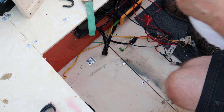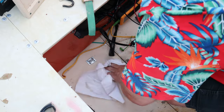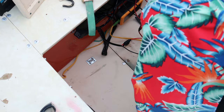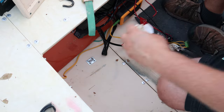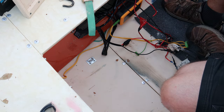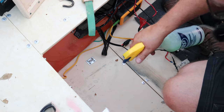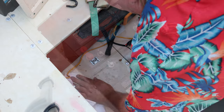There's advantages to the starboard half-inch flooring I put down in this boat. But, mind you, there's plenty of disadvantages as well. One of them would be temperature. In the direct sunlight, this floor will get hot. If I had it to do over again, I'd put a plywood floor in it again. Original plywood floor only lasted 40 years. Why did I think I needed to improve on that?